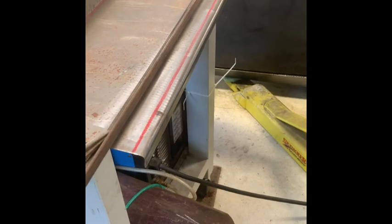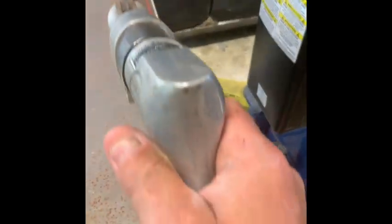When you're making bits like gutter and stuff, it's very important that you get straight lines, and it's quite important that you get it even. So if you can clamp a piece of metal to follow along to get your cut, in this case I'm using this air tool to cut it, and this will run down here, and hopefully I'll get a nice clean edge.